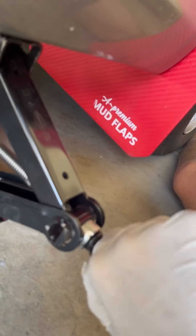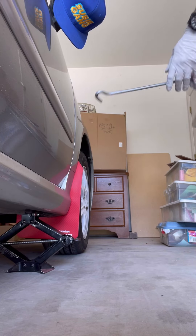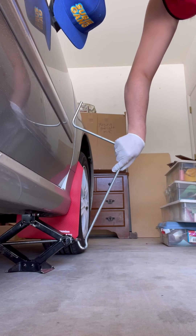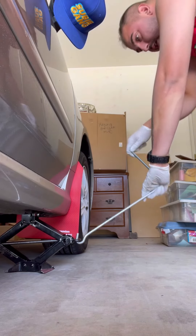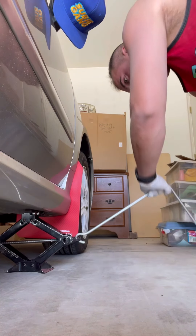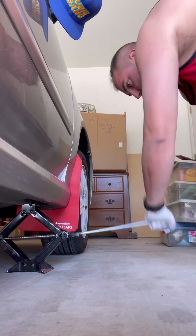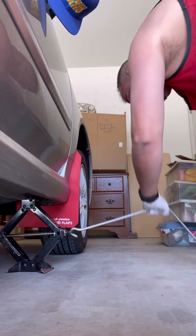I'm using the jack that comes with the car. Just place it right there on the frame rail, right behind the wheel maybe a foot back, and raise up the jack to get a nice good grip on the metal frame. Put the hook through the ring and just turn it to the right. I sped up the process because nobody wants to see me raising a vehicle for a minute or two.